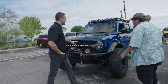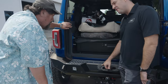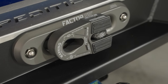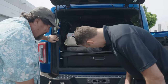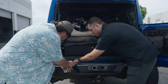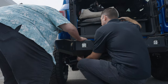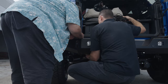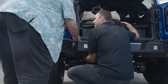The last thing is winch operation. This is your winch — you know how to run it already. It's just the rear winch operation. Factor 55 Fairlead and Factor 55 ProLink. This is the slimmest Fairlead they make — it's anodized in gray. It follows that contour cutout beautifully and gets it tucked up away so you're not sticking out past the bumper. For winch operation, we have this thing tucked up out of the way. It's a straight singular centrally mounted winch, but we relocate the control box off to the driver's side so you've got access down there. We want it accessible enough for you to get to it, but not so exposed where it's going to take impacts and get beat up. You can see that control box right in there — there's your cover. It's hidden, but not hidden to make it hard for you to get to. We don't want it to take a cake with debris or get hit on rocks, but we need you to be able to plug things into it.